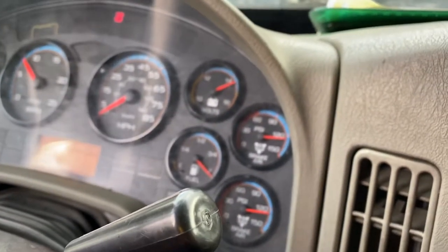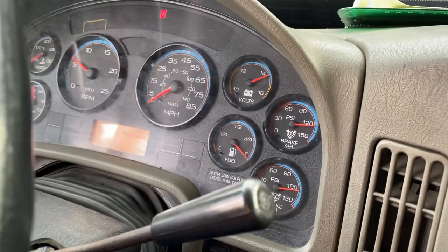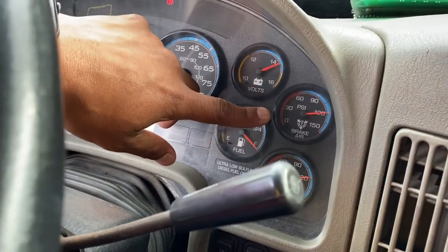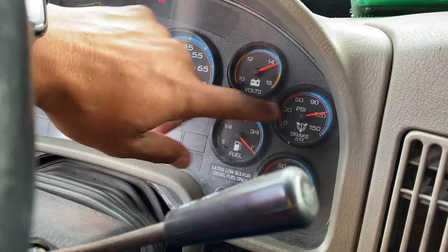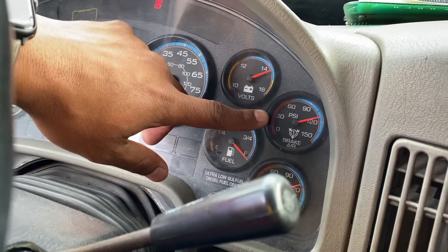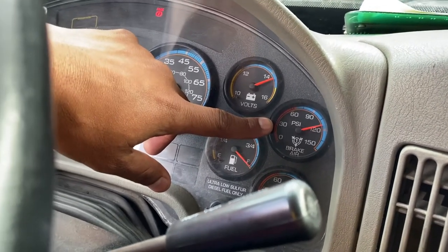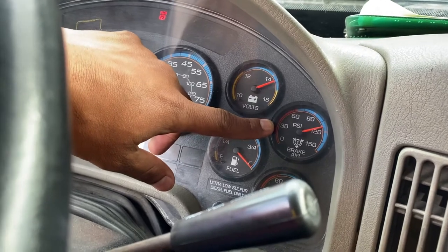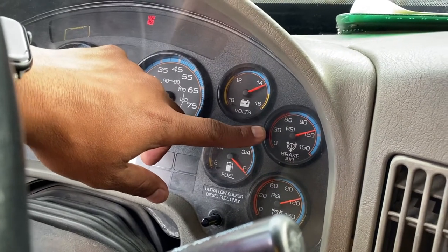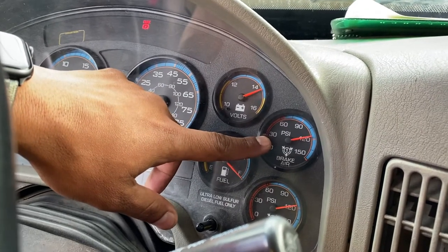All right, so now it's my cut-in. The cut-in is when the governor turns on the compressor, and it should be no less than 100 PSI. To perform the test, I'm gonna fan my brake once, wait till my needle stabilizes. Once it stabilizes, I wait 15 seconds and I see if I gain any pressure. Okay, stabilized at 115, my time starts now. Okay, 12 seconds in, I started gaining pressure, making this a good test because I didn't go below 100.